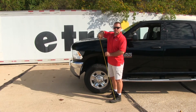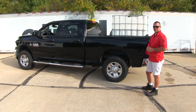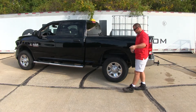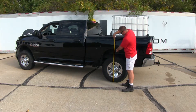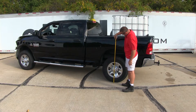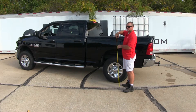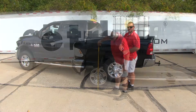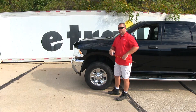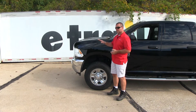It's a good idea to take note of those measurements. We've added about 1,500 pounds to the back of our truck. Let's take that measurement again on the front and back. Center of the wheel to the bottom edge — looks like we're at about 41 inches, so we've dropped our back 2 inches. The front is still about 40.5, but if we add more weight, the front is going to raise up more.